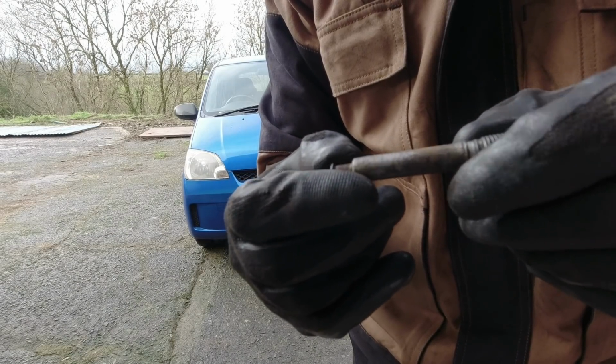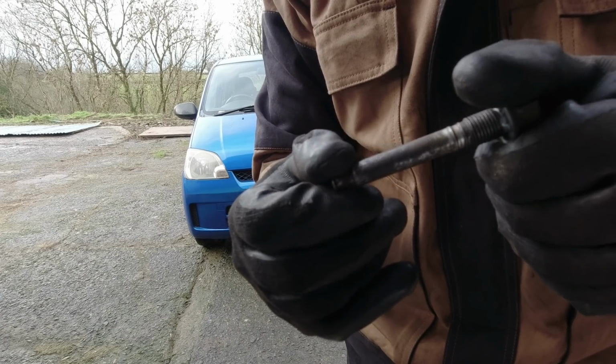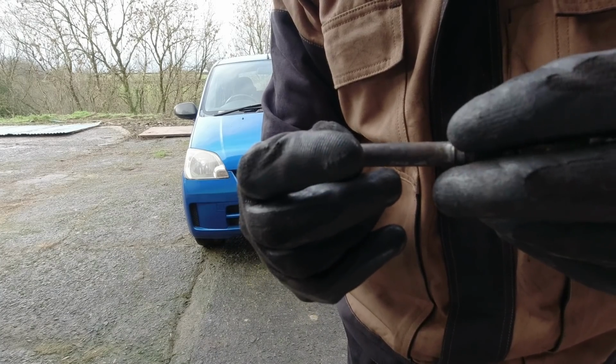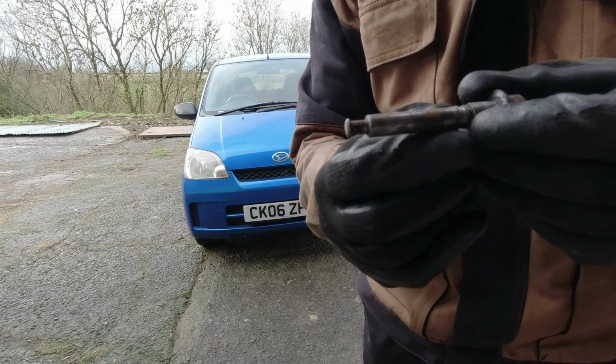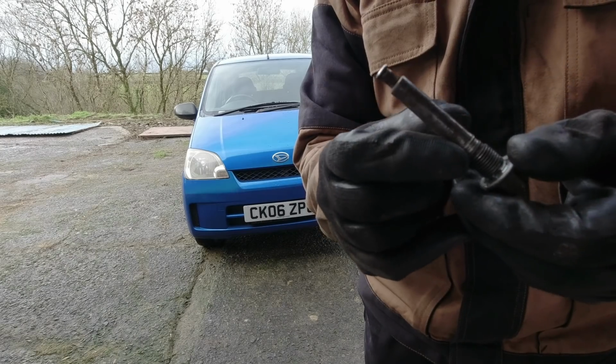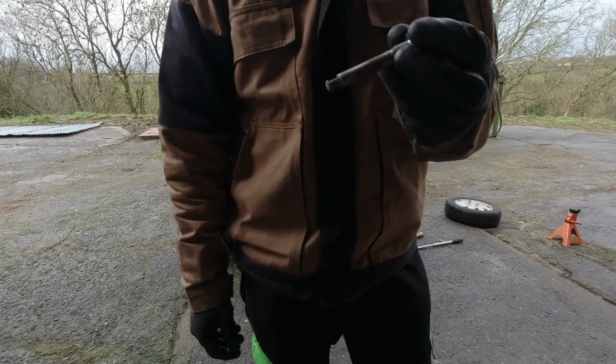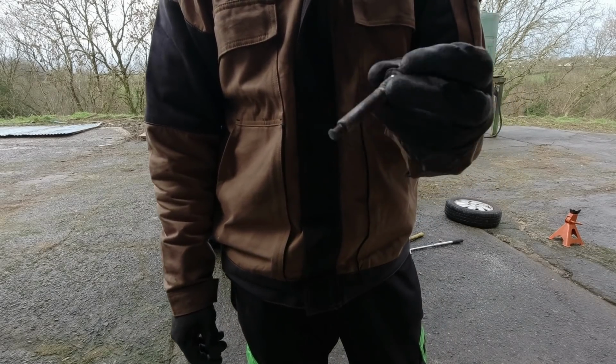But I think we're nearing the stage where it's just going to have to be lube and hope. But yeah, replacing those pins is going to be a good idea, I think. And it might be an idea to do the pads while we're at it, fresh pads while we're in there. That's okay. Miss Hubnut's quite interested in learning about brakes, and she can learn how awful sliding pin calipers are,